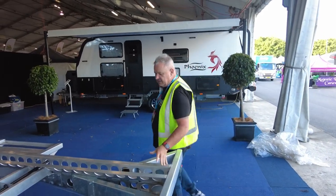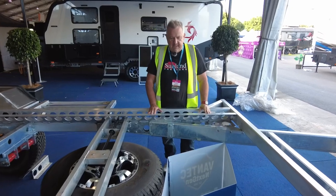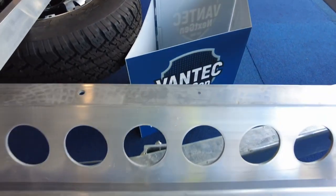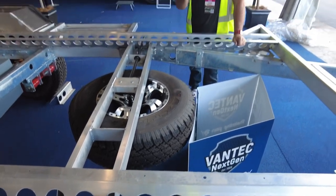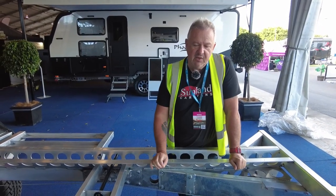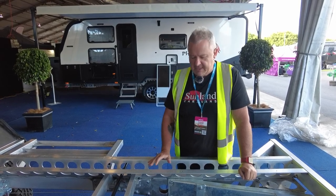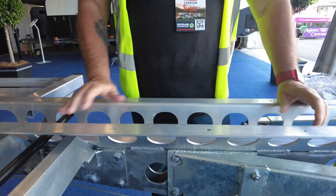We take this hot-dip galvanized A-frame and attach it to the aluminium rail. This aluminium rail is very specially made — it has two centres, with an upright and a section that comes out at an angle. The holes are there to remove unwanted material, keeping the chassis rail nice and light. When we attach it to the A-frame we fit crush-proof tubes inside the aluminium so that bolting it up doesn't crush it, and we use a compound between the aluminium and the steel to prevent oxidization between the two different materials. The final result is a super-light but incredibly strong chassis.